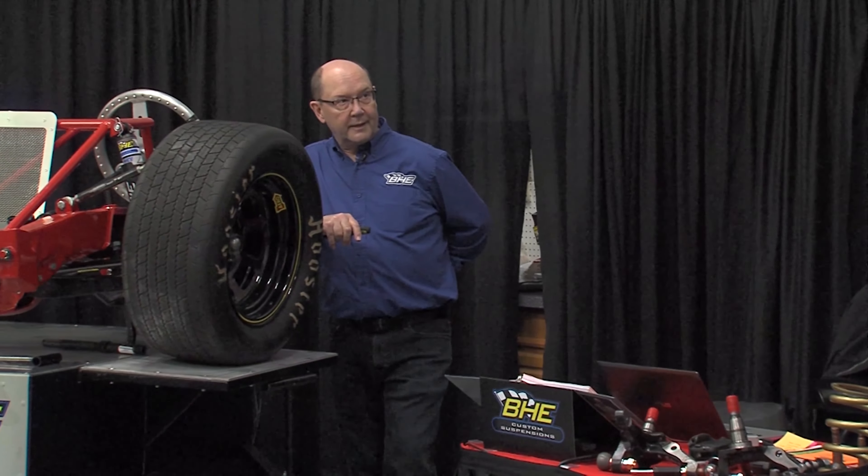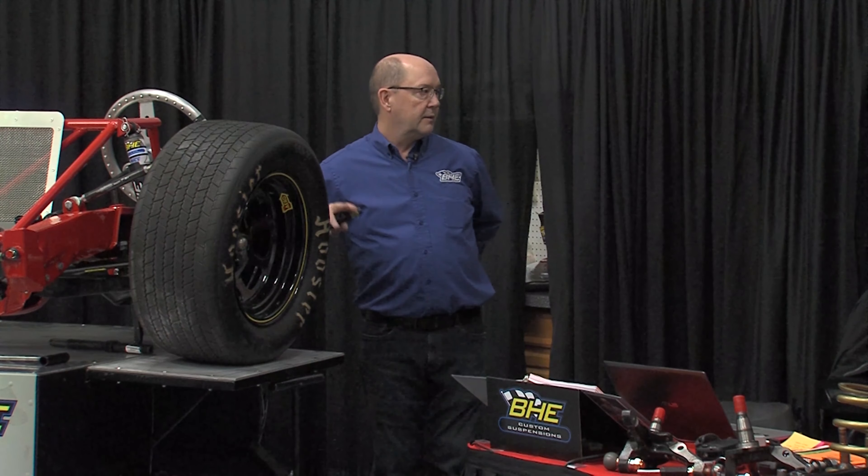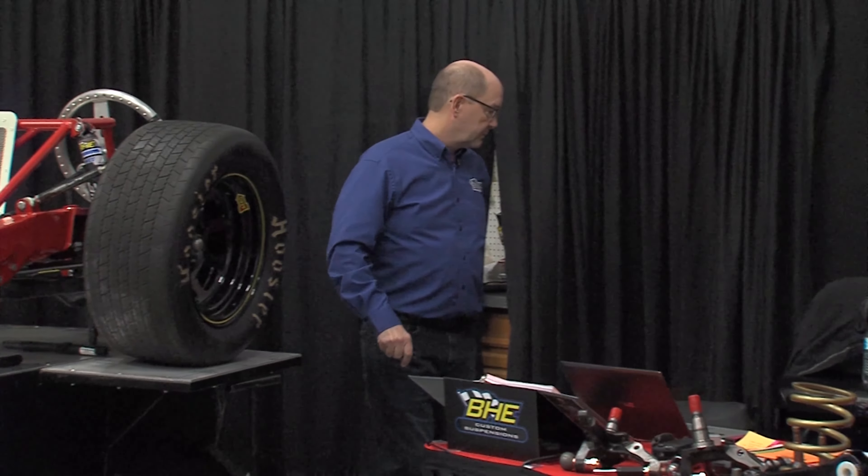Kelly is going to explain his tire grinding method. On a right rear tire, the edges we're looking for traction are the front leading edge and the outside edge — the beadlock side. Those are what we call the drive edges. The front and outside edge of those drive edges are the key traction points.